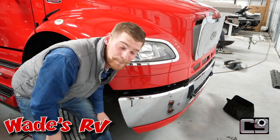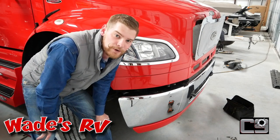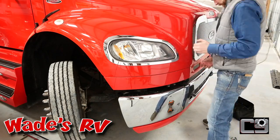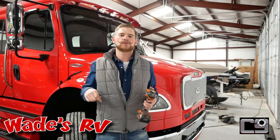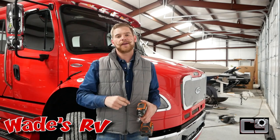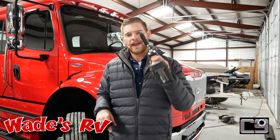The passenger side is a little bit more difficult. There's a rubber protector on the side of the radiator that I'm having to work around, so it's taking me a little bit longer, but I will get her done. What I ended up doing to make it quicker was popping the hood and holding the grill with one hand, working myself around the hood with my other hand, getting it started, and then popping the hood again and using my little impact to get those tightened up. Make sure you always have a deep socket — half inch, and you're good to go.